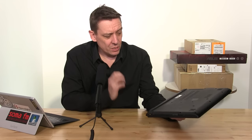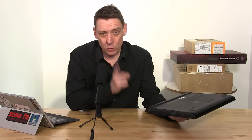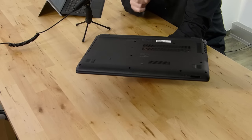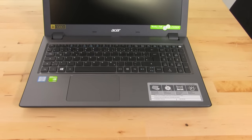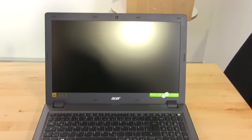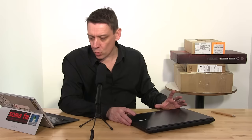There's no access hatch on the back and the battery is not removable, though you can presumably take it apart to access the disk. There's a one-terabyte spinning hard drive — not SSD cache enabled. There used to be an mSATA port in a previous version, but since the DVD writer has been added, that port is gone, so you won't be able to drop an M.2 SATA drive inside.